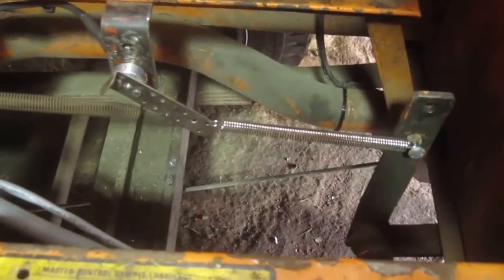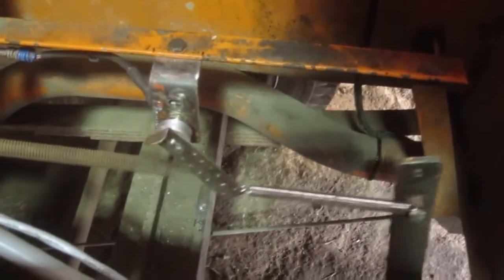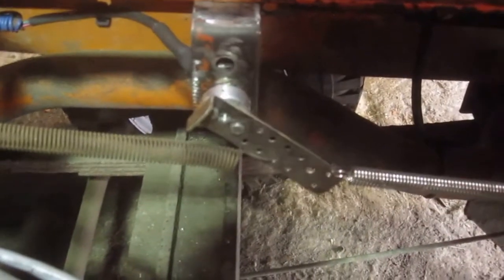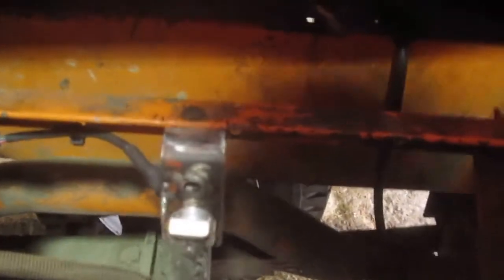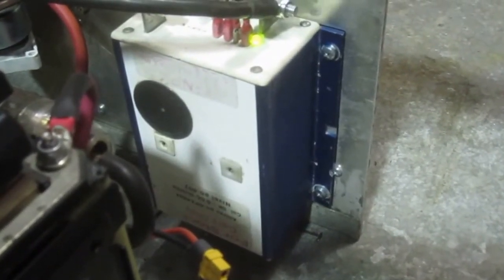When I pull on the main, I'm depressing the throttle pedal with my hand and the pot gets pulled through. It's only about a 45 degree range for this particular pot, so I drilled a bunch of holes into the bell crank and fiddled with springs until I got the behavior I wanted. It goes about 45 degrees forward and back to zero — at full position it's 5 kilo ohms and at minimum it's down to 0.5. The second-hand controller I ended up with was an NPX configured for club cars with a 3-wire throttle, 5 kilo ohms to zero.